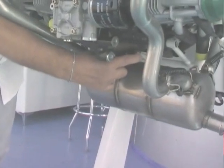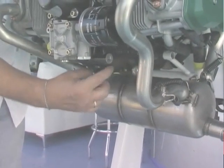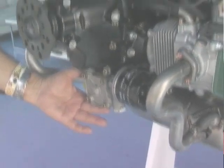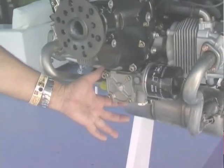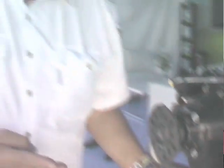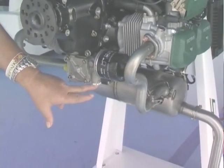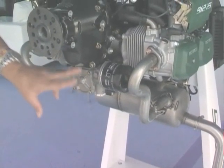We've done away with the banjo bolt at the bottom of the engine. Now we have recovery fittings coming off to the side — on the ignition end for a tractor version and on the gearbox end for a pusher conversion. The oil pump itself is physically larger; we've increased it internally from a four-rotor system to six rotors, which reduces pulsation sometimes seen on oil pressure gauges. In addition, we have a much larger pressure relief valve internally, so it's been completely redesigned.